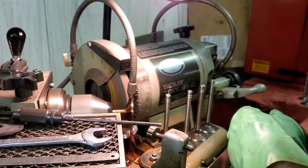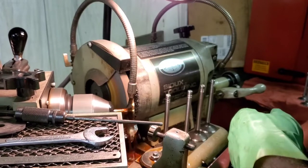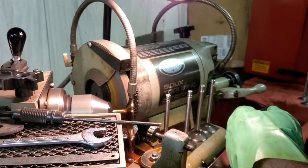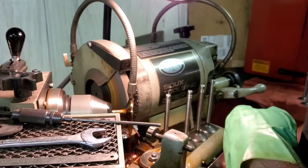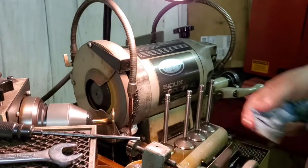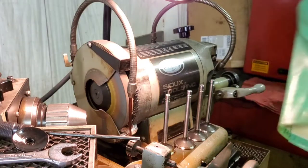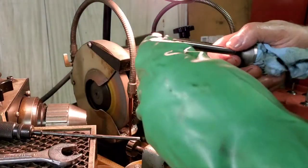Some guys just chuck them and grind them right where they're at. But if you have just a little micro-dirt — just something in there — a few tenths diameter, it can make it run out. That said, it came out pretty good. To true up this valve brand new out of the box took about one thousandth — one to three thousandths is about normal. Sometimes you have to hardly take anything.